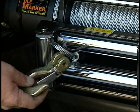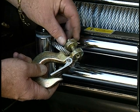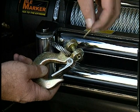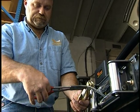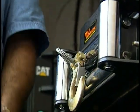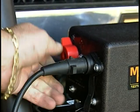Finally, attach the hook assembly to the cable. Insert the cotter key and, using a pair of pliers, twist one of the stems back to lock it in place. Now to use the winch, simply plug the remote control in and you're ready for action.